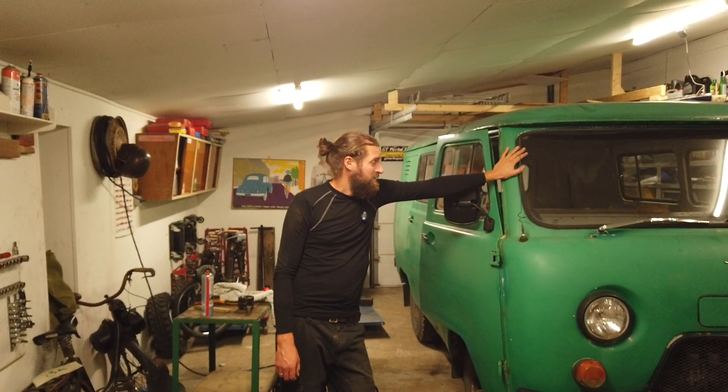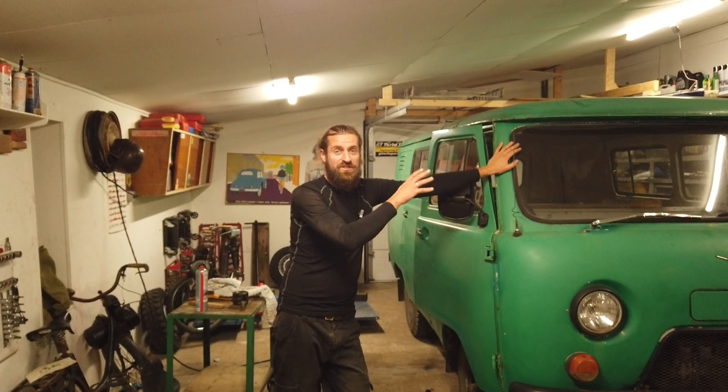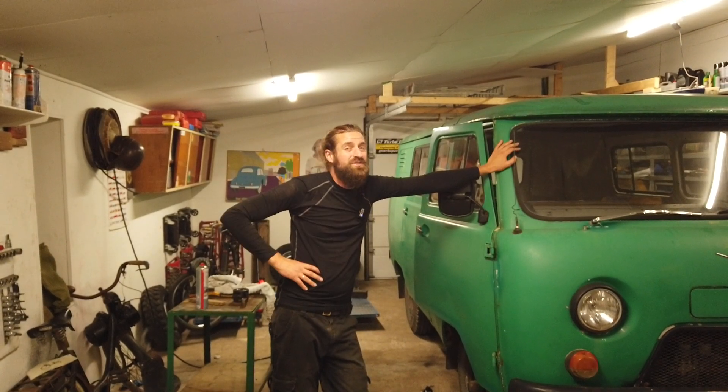So that wraps up another episode. This was just a small video changing the oil and checking the general health of the engine. There could be a lot of stuff wrong with it still, but this gives an indication that this engine is pretty healthy. There is still a long way on this project, but this tells me that I don't think I will have to do much work to the engine — I will just have to clean it and service it. I know the coolant system needs a great flush because it looks like the Mississippi River down in the coolant reservoir — no sign of oil, but signs of rust. Also, almost all the hoses, fuel lines, and airlines are very perished, so I will have to change all of them. A long way to go still, but this was one very important step closer.